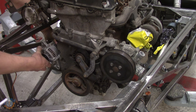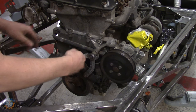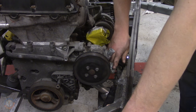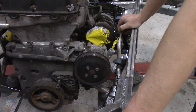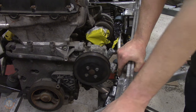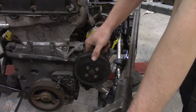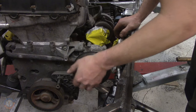Starting to look at where to mount this generator — or alternator actually. I start by removing the original tensioner. The problem here is the water pump. This bend here cannot be as it is; it needs to be either forward or backward, up or down. Because you have this side here and I am not going to move this pipe, because it is used to strengthen everything up. So we need to remove this one and see how it is — there is also some play here and the bearing sounds like it is shot.